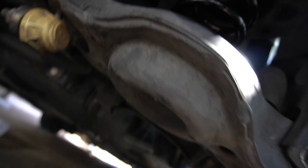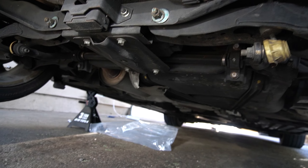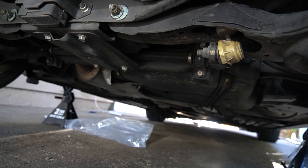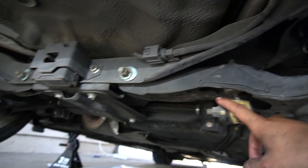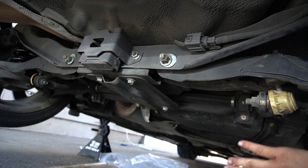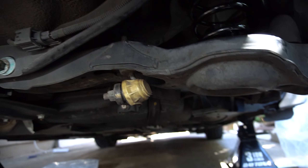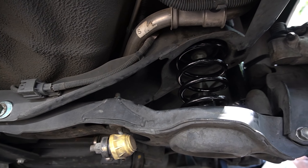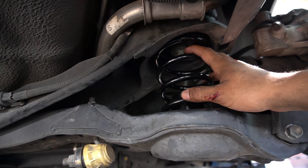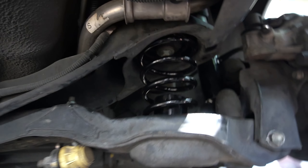Push this down and the whole unit comes down as one. Next, take off this 14-millimeter bolt on both ends — you'll need both rear sides up because once you take off one you can't take the other off. Once you take off both you can slide it over, it can freely go down. Then it's simple: put the spring in with the coilover — the coilover goes on the bottom. Put everything back the way it came off.